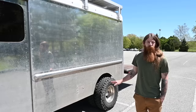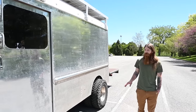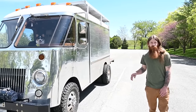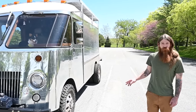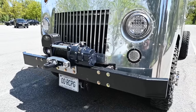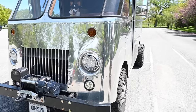Starting off on the body, I found a 1953 Grumman curbside and restored the whole exterior. When I originally found it, the body was left in a bog for about 50 years — parked in 1970 — so it didn't have any glass, any floors, no frame. I built a complete tube chassis for this van for this specific wheelbase of 10 foot. In the front, I designed it around an E350 suspension front and rear with the dualies and a 7.3 Power Stroke diesel.